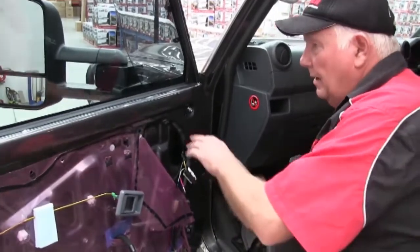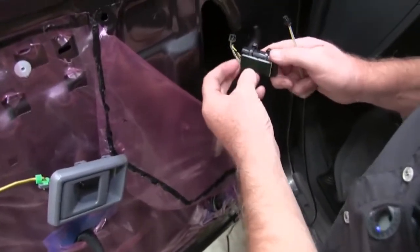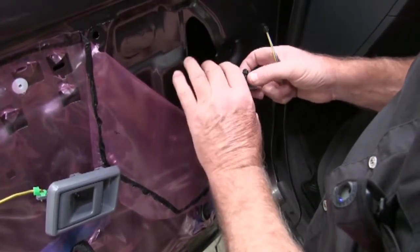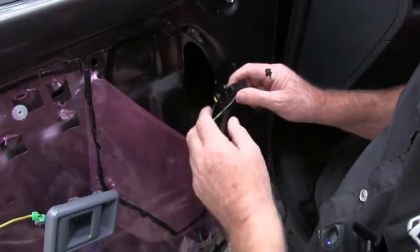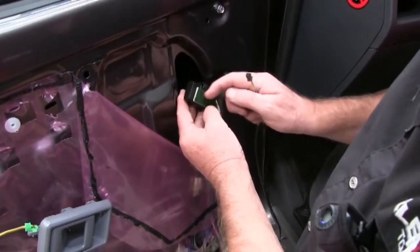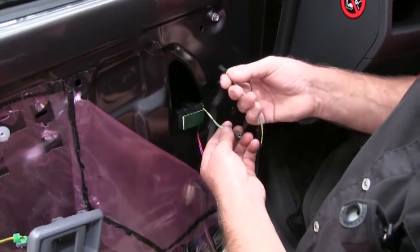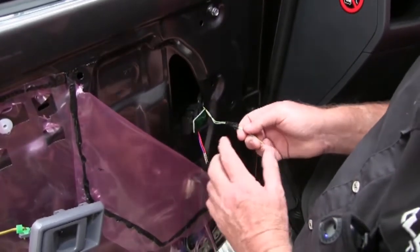Now what we're doing is wiring the power fold mirror with the wires that come out of it. We've got our little brain box here. We went to Jaycar and grabbed some of these clips — you put a cable tie through them and then double-sided tape on them. We're going to come around the window track. Make sure that you don't put it through the window track, because as soon as you put the window down you're going to pull all your wiring out. So we're going to mount this right there on that blank bit of panel on the inside by removing the backing off the double-sided tape. It will sit in there, it's out of the way of everything, and you've got access to the wires down the bottom — which is from your switch. Once you plug that in, you're good to go.